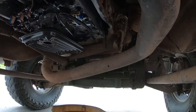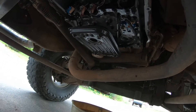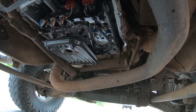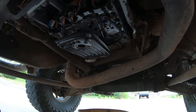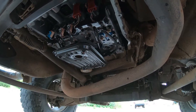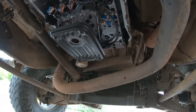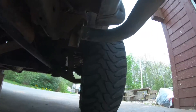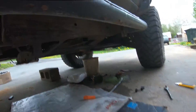A little bit of moss and stuff hanging under here — had to clean it up a little bit. She gets used hard. This thing got about a hundred thousand since I last serviced it, if not more. I serviced it when I swapped it, so God knows what was on it beforehand. Anyhow, I only drained the fluid the first time, so this time I'm doing the twist-on filter, the inside filter, and all new synthetic fluid.